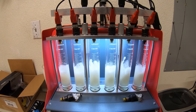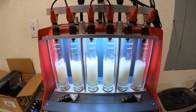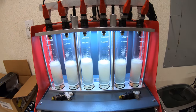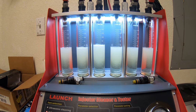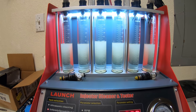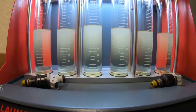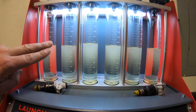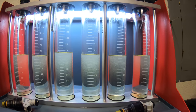With bad sets at initial you'll get one that won't even open, the next three will be good, then one's halfway, and one's okay - all over the board. If they're good, they'll all match pretty much right away. So I'm going to hook up all the injectors and run an initial test, right out of the car, and see how they look. After letting it foam down, you can see they all equal out - they actually look really good. Number three on this machine has always shown a little bit higher than the rest across probably 10 sets, so it seems to be a machine quirk.